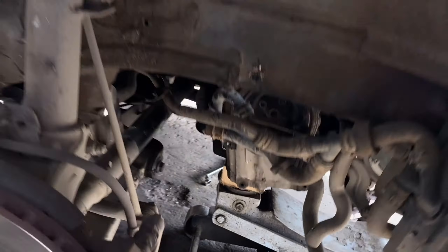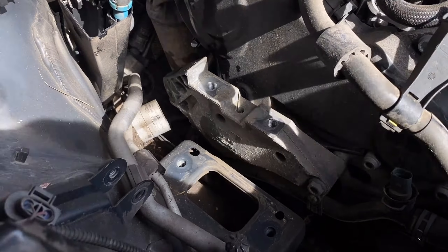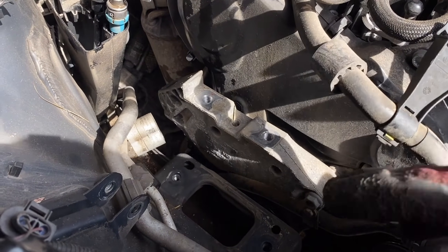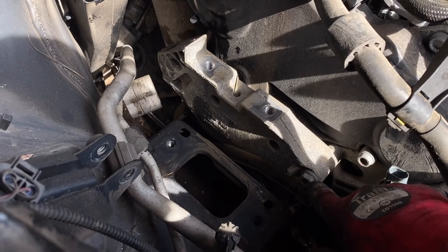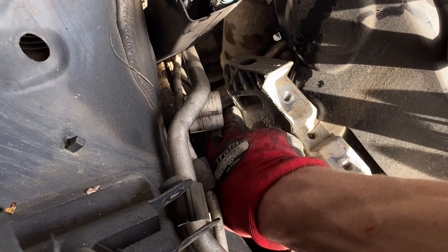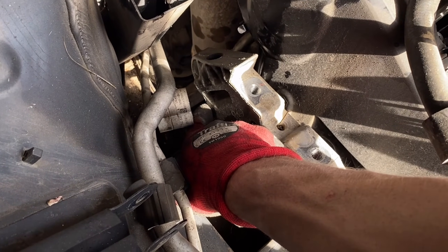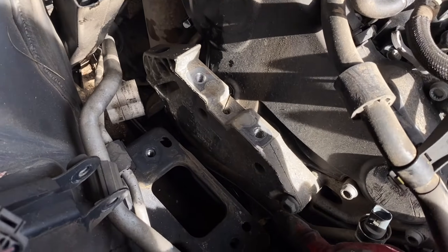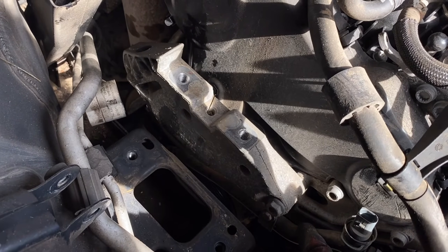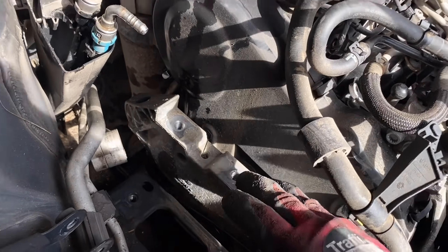I've got my sockets ready. I have also got the jack underneath — that's why it's good to have it slightly off the floor. Jack's underneath with a block of wood under the sump — make sure you do that before you undo these bolts or the engine will fall out. Engine mount is off. Now I've got the engine jacked up slightly. We've got a 16mm here and a 16mm buried under there, so you need to jack the engine up. There's a 16mm bolt under there — you do this from the top, you cannot do it from the bottom. We've also got some 10mm bolts holding the water pipe on.